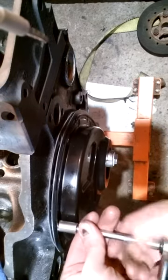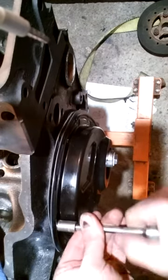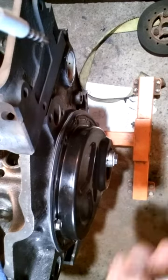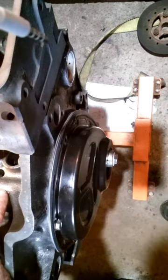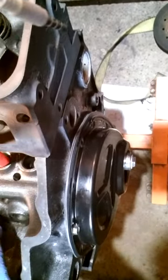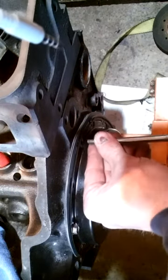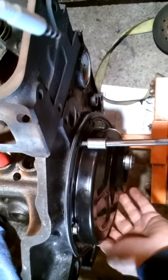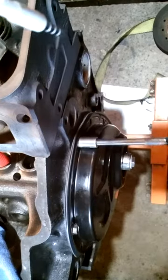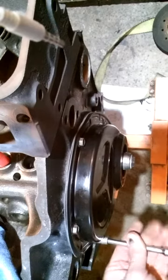The cam button controls the movement of the camshaft. Normally a roller engine will have a cam retainer button that holds the camshaft in, but we don't have that provision on our block — there are no holes in the valley pan here. There would be three holes to hold the retaining assembly that holds the dog bones that holds the lifters in. Some people like retrofit lifters because they're supposed to be better for racing than factory lifters.